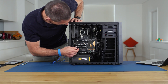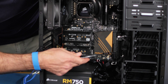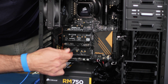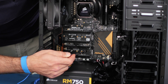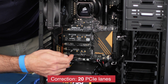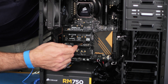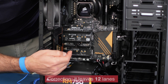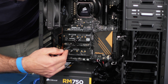With the case off, we can see the three M.2 sockets. I'm going to populate two of them. I've also disconnected the SATA cable for the existing SSD to make sure I'm only booting off these drives. An important note: on this Z170 system with the ASRock Extreme 7 Plus, you only have 16 PCIe lanes. Each PCIe 3.0 x4 M.2 SSD consumes four of those lanes.